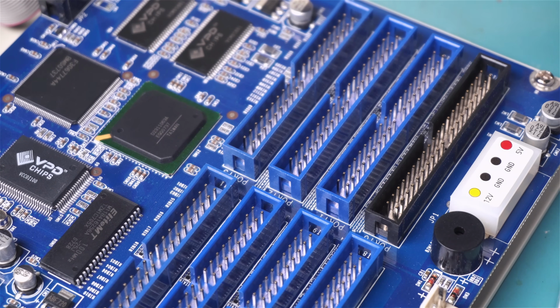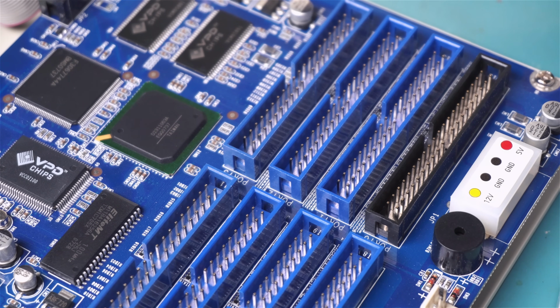They do make newer ones with tons of serial ATA ports. These ones are both parallel ATA, so they're kind of wasteful in their space. This controller board is rather large because of all these connectors, plus there's also the giant bundle of cables that come off the board to all the drives, which means the actual chassis is quite a bit longer than it really needs to be if you were using smaller connectors. If you replace it all with serial ATA.